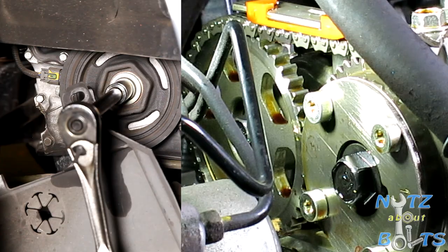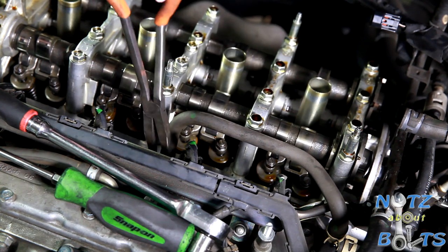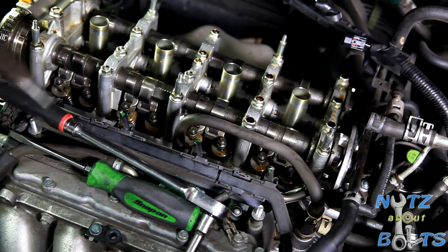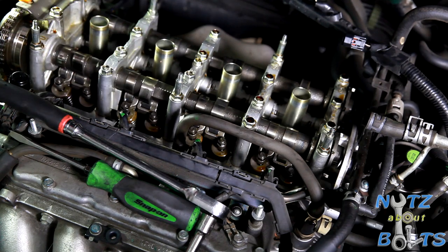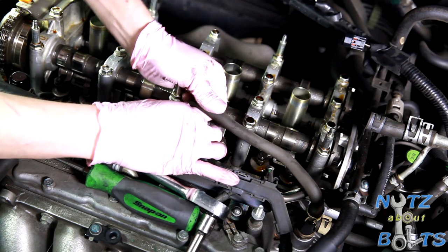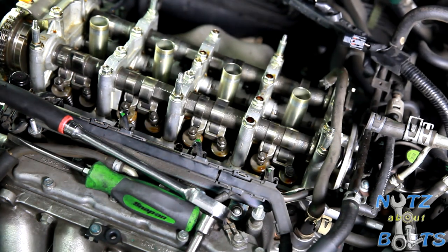So we'll use our feeler gauge to check those. The next cylinder after one is three, and there's a little bit of an obstruction here with this hose, so I'm just gonna go ahead and unclip it there. Use the pliers to break it free. Okay, that should be good. Yeah, here it's coming. Okay, so we'll just push that out of the way. And now we got room to get to number three. Let's see, we'll do the intake side.